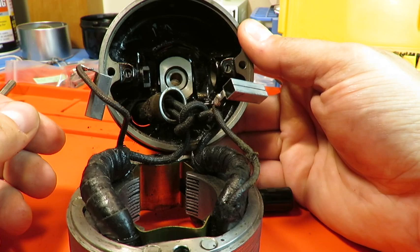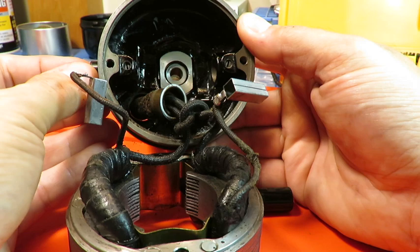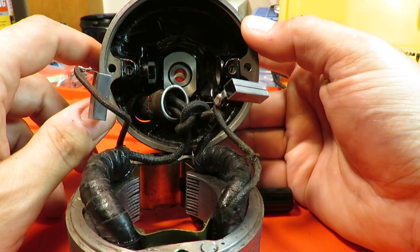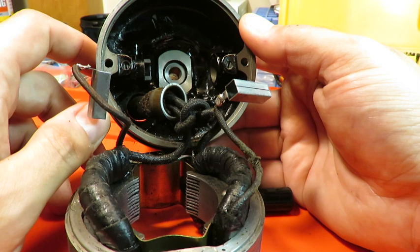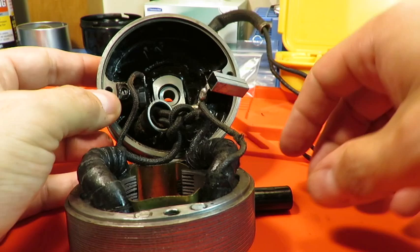And then also, knowing where that flat spot is to fit it right behind the grub screw there, I recall from the photos that really it goes in about that far, and that's the way I found it, just about that much. And so I'm going to put everything back together and get it in shape to fit the rest of the motor back together. So I'm gonna put this brush box here into the holder and then fit this guy on the other side.